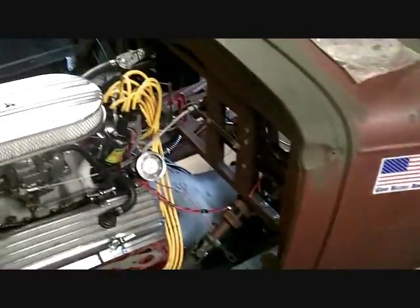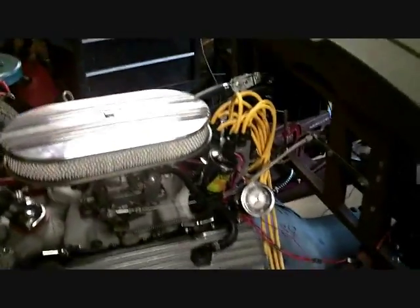Up front I have about an eighth-of-an-inch lean out and here it's about an eighth inch below, but we haven't messed with the hinges really. I'm going to plug the key lock holes and the handle holes and all that stuff. My bottom edge now is going to be huge — that frame rail is five inches. I think I'm going to end up reskinning this door with something else, I don't know what yet. Once that bottom edge is done, the panel will be the height of the frame on the lower edge. Now I'm out of gas — I've got to get gas for the welder and I'm hoping to do that tomorrow because the place isn't open on the weekend. I thought I had smoked my coil the other day — a curl of smoke came from the coil. Turns out I was just overheating it because I didn't have it on accessory, I had it on ignition. But I checked, it's fine, it does have spark.